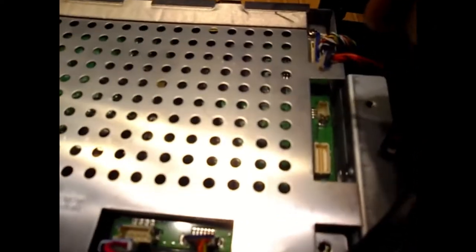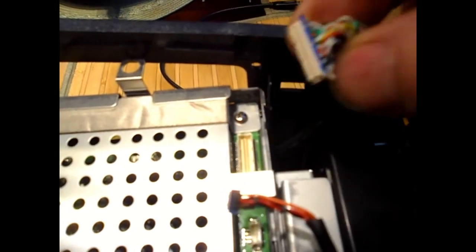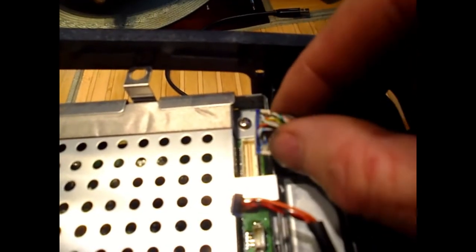So when I put this plug back in, I've got to take a small, tiny screwdriver and push the wires into their spots there. So you're going to have to take a screwdriver and pry gently on one side of the plug, and then the other side of the plug, until finally it works itself loose, prying on the plug itself. Don't pull on the wires.